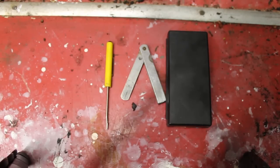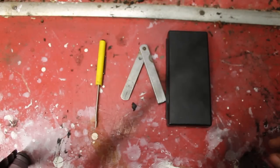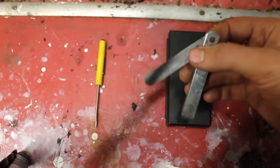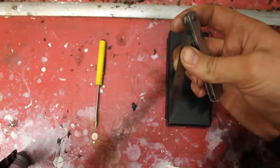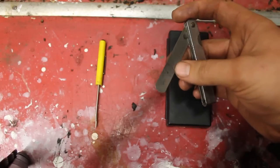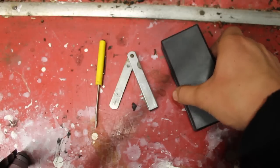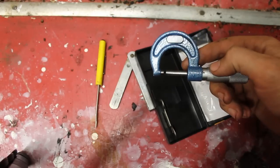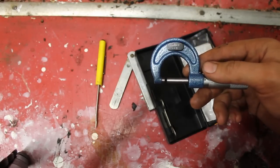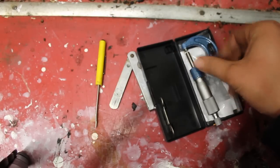Excluding basic hand tools, this is what you're going to need to do the job: a small screwdriver, small enough to pick the shims out of the buckets; feeler gauges, which are accurate strips of metal in different sizes used to measure clearance between two objects; and external micrometers. You can use verniers for this job, but I prefer the micrometer — it's easy to read and highly accurate down to a thousandth of an inch.